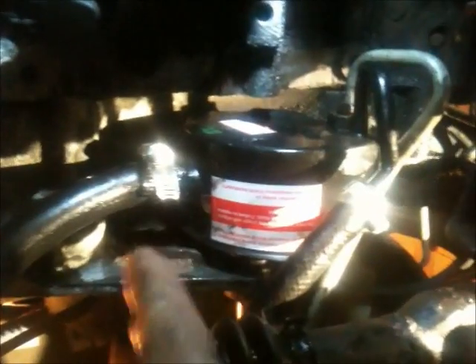Working on the hoses still — this is the correct tool for the job. Once you get the pressure fitting and the pressure hose tied down, the rest is just a piece of cake. The pump is in, all three hoses are in. I replaced the clamps with new ones — it's not easy to take the factory ones off. All three hoses — one, two, three — are set. The pump is tightened down, except the rear bracket and the pulley.